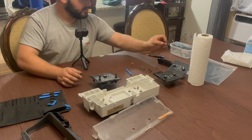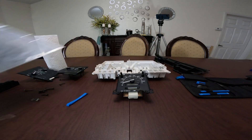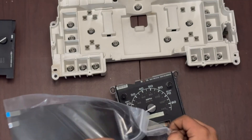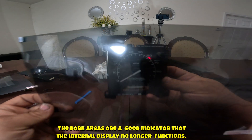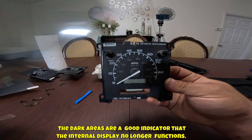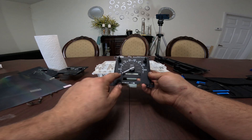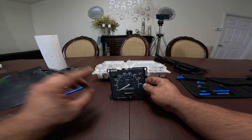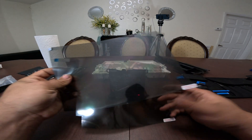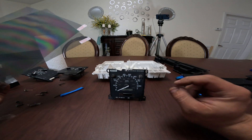What I found online are these polarization layer replacement sheets — I'll leave an Amazon link in the description. This is two layers of them; you can see how the lens changes when you hold them up. It's pretty crazy. There's some adhesive film still stuck on the display, but we're going to use a little Goo Gone with Q-tips to get that off. These sheets are self-adhesive, so you just peel the old layer off, clean it, stick one of these on, and the LCD should look beautiful again.